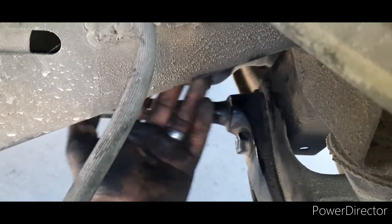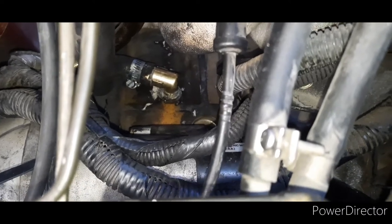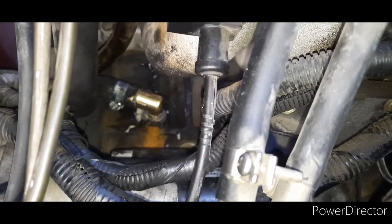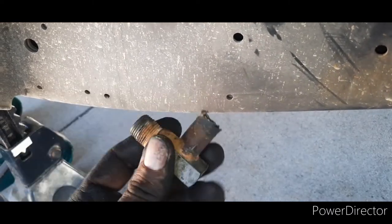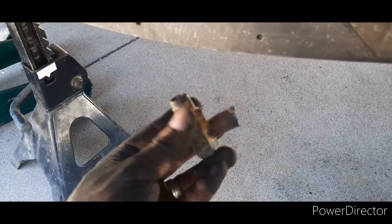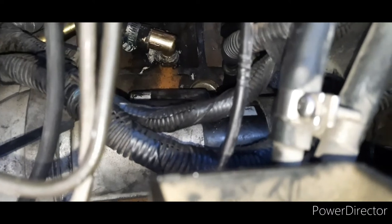What I ended up doing, because this thing is very low, is I just grabbed it with some channel locks and bent it upward a little bit so you can stick your hand in there. Very tight. The starter does come out — it goes down here and comes out to here. It's finicky but it'll find its way out on its own. I tried looking for the original part at auto parts stores — it's a very weird pipe tube thing, like part of house tubing. Auto parts stores don't have it; it's probably dealer-only. It's called something like a heater connector tube. It goes through the passenger side wheel well, and the starter has to come out for that thing to come out.